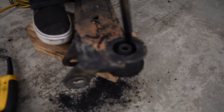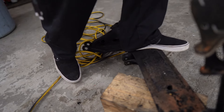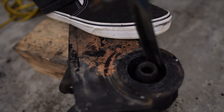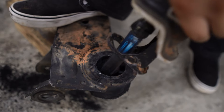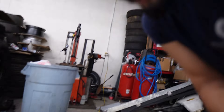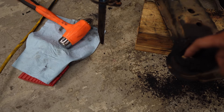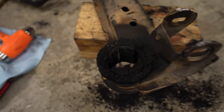So what are we doing today? Cutting this rubber piece. We drilled it, gave it some space, and that way it's easier to cut around it and take out the bushing. This thing actually has slits already — two slits. You see how that one's like separated? You just need to squeeze it. We finally got it — we were able to cut around it.